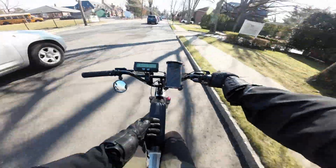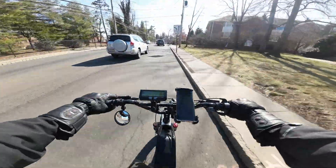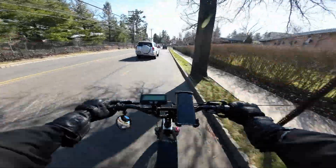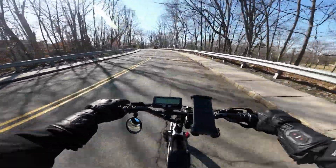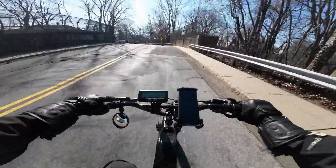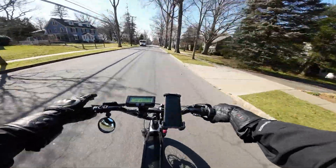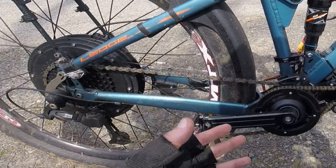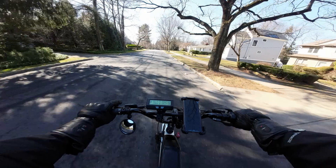But to be honest, this system here is awesome for what it is — I'm very happy with it. So if you already have a bike with a geared hub and just want to squeeze out a little bit of extra performance, you can do that with the Phase Runner, and it makes for a pretty awesome package. When it comes to mid drive motors, we have Bafang and CYC — those are the two main options, and these are reserved for more enthusiasts: off-road riding, hill climbing. The internet loves mid drive motors, but you do have to be cognizant of the maintenance. For example, the cogs on your back wheel — the gears — for a regular bike are not designed to have 2000 watts of power being run through them, and they wear out pretty fast.